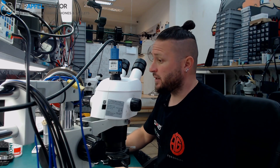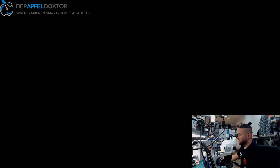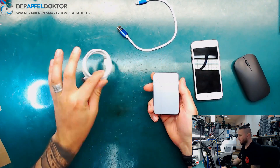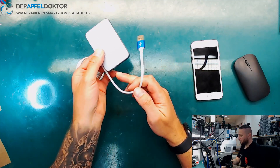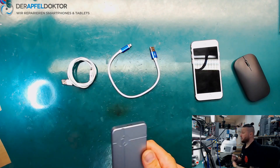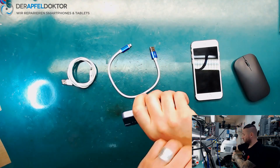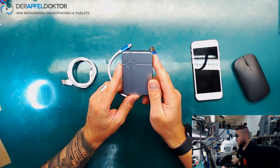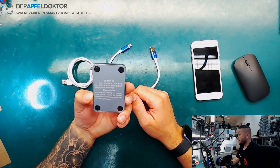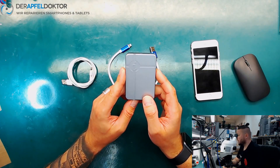That is what the iBox Mini can do, and I want to show you that beautiful tiny little thing here. So we go straight to the on-hands camera — that's the iBox Mini. The iBox Mini comes with a lightning cable and with a cable which you can connect from the iBox to your phone. This is all what you need. If you have these tools and you have the software, which you can download — I will paste the link under the video — then you can download, get the iRepair P10 or the iBox Mini, and you can modify NAND data, unbind Wi-Fi, and things like that.